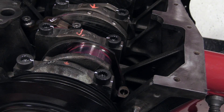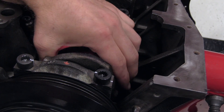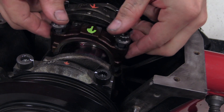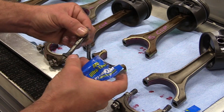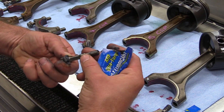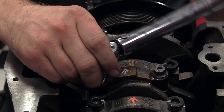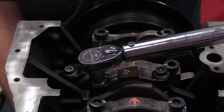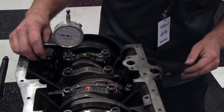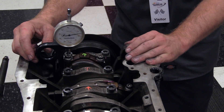Once you have a piston installed, I like to rotate the crankshaft so that the journal is at the bottom, which means the piston will be at the very bottom of its travel. Before attaching the connecting rod to the crankshaft, make sure the bearing is lubricated, the journal is lubricated, and the bearing is still in its proper place. Next, lubricate the bearing on the cap and install the cap. Lubricate the threads of the bolt, the shoulder of the bolt, and the landing area on the cap — those are the highest stress points. Snug the bolts down evenly and torque them all at once following the manufacturer's recommendation. For the connecting rods, I'm using ARP bolts — there's a video coming out soon on exactly how to do that.